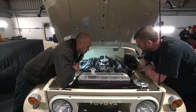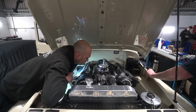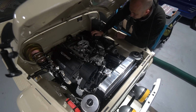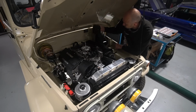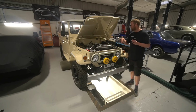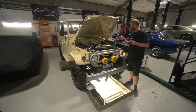Now, we did actually find some problems. The inlet manifold's in two halves, and I thought, well, maybe it's the O-ring that joins the two halves of the manifold. We did discover that the bolts holding the two halves together were just fractionally too long, so they bottomed out without it being fully pulled up. And I thought, oh, that is exactly what it is, air squeaking past the O-ring. Resolved the problem, but it didn't solve the squeak.